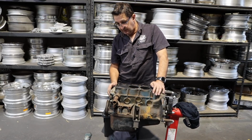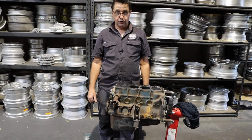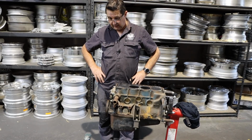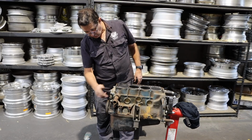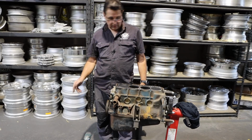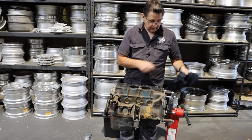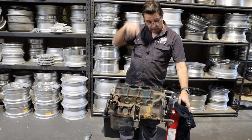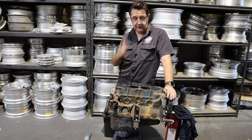So next thing now is to get the cam out. The cam we're going to take out is going over to Kelford Cams in New Zealand, and they're going to grind me up what's called a 92 grind, and combined with the Doughty throttle bodies, we might even double the power from 20 kilowatts to 40.